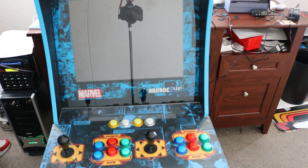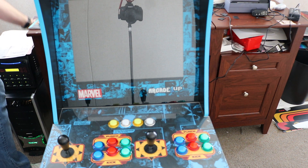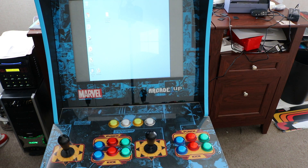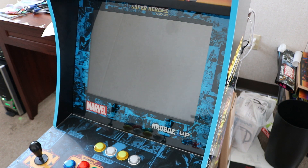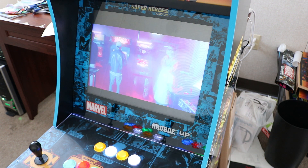I have that still connected up, everything's connected in the monitor. I'm just going to take the HDMI and plug it into this different resolution from my computer and see if I can get that to reset it. I've had some success doing this. You can see now I actually do get a picture — it's not that jumbled mess that we saw a minute ago. So I'm going to reorganize this stuff and replug in the Pi. I got it plugged back into my Pi and it looks like I have my monitor back — so that fixed this one.